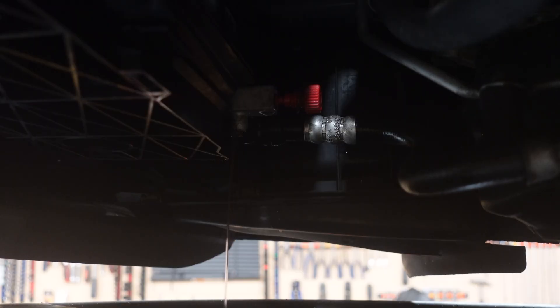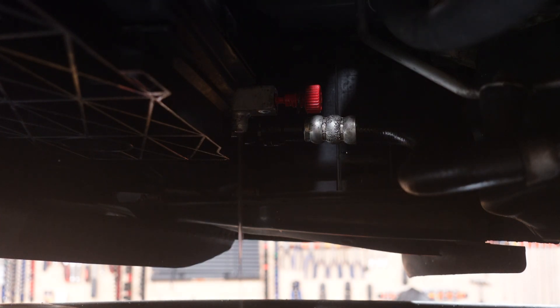As you can see, we're now just gonna turn this until it loosens. The coolant's now coming out. You can see it is dripping, but very, very slowly. And if I press on the top lower radiator hose, you can see it come even faster — that's why it's pushing all the coolant out. I think this is probably because this car has been sitting and not been driven. So we are just gonna leave it to finish. But that's how you'd actually drain your coolant on your BMW.